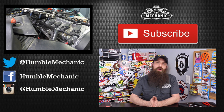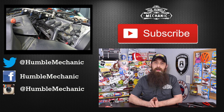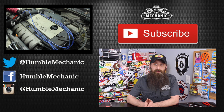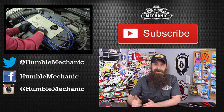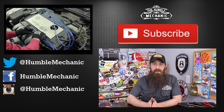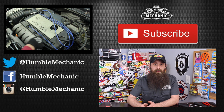One final note: a lot of what we talked about today is based on a factory vehicle. If you have a modified vehicle, then a lot of what we talked about kind of goes out the window. If you have a factory vehicle, I recommend following what the manufacturer recommends for spark plugs and really most everything else. Volkswagen for the my AAA VR6 recommends two different plugs — an NGK and a Bosch. Both are great; I'm running the NGKs and have had really great luck with them. This is one area you definitely want to follow what the manufacturer recommends.